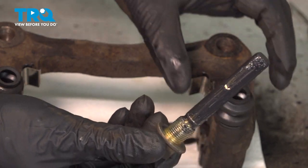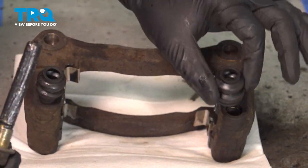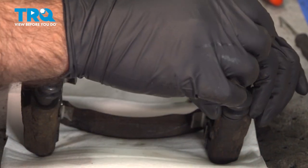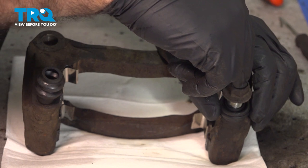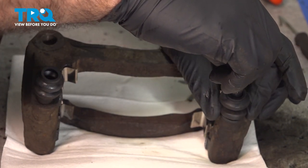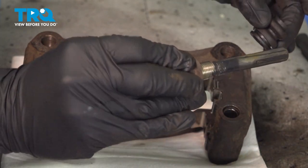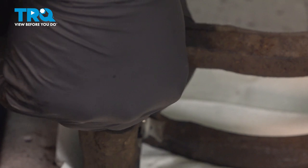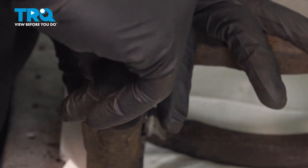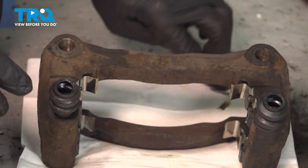We're going to take our greased pins and put them into their areas. Remember, this is the wrong boot for this caliper, but we don't have another, so we're going to use it. We'll put it in place and press the pin all the way down into position. What we're going to do is push the pin all the way in and pull it all the way out — what that did is put a nice coat of grease inside and evened out the grease on our pin. We'll do the same on this side. Make sure they move freely and don't bind up — make sure you have no issues going in and out with it. Then take it out and set this pin aside. Now we're ready to take this to the vehicle.